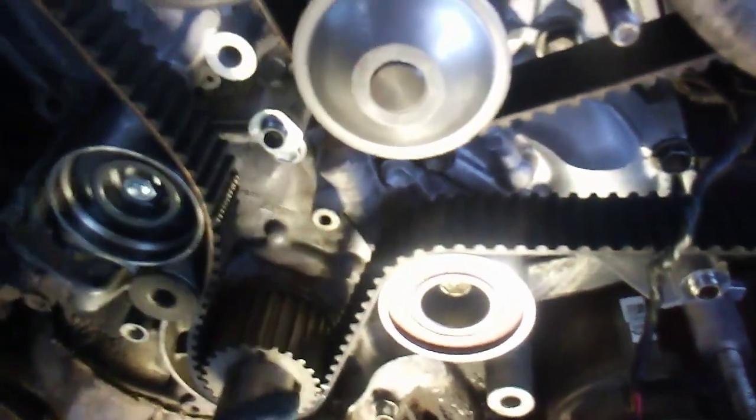So that's that. This side's tight — tight all the way around — this side's a little loose, because I'm about to put the tensioner in and pull the pin, which is gonna make the piston go up and put pressure on it. Driver side: there's the left cam with the timing mark, the T, which lines up with that dot. The T over here lines up with that dot, and that lines up. There you go.